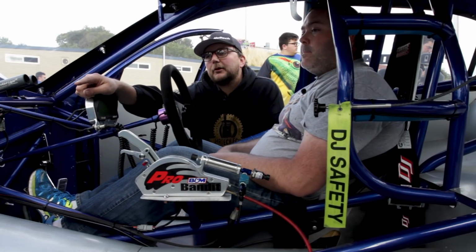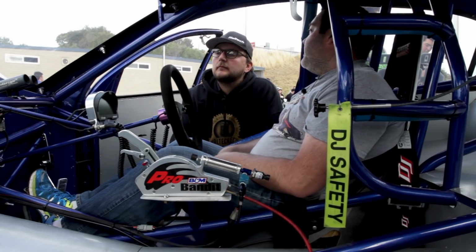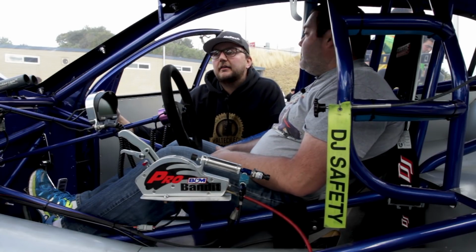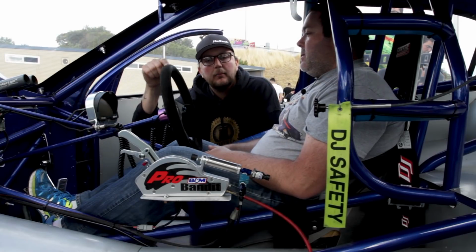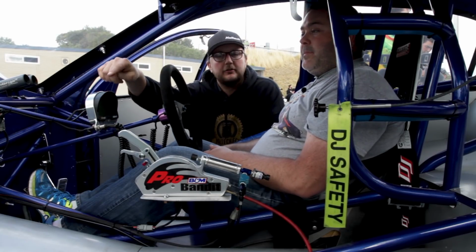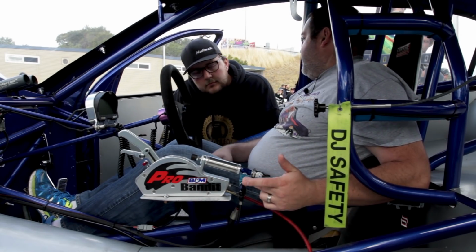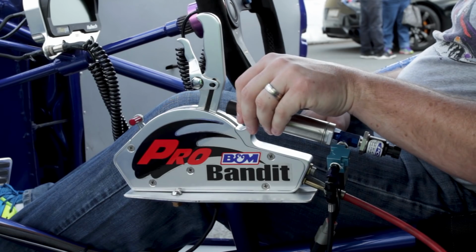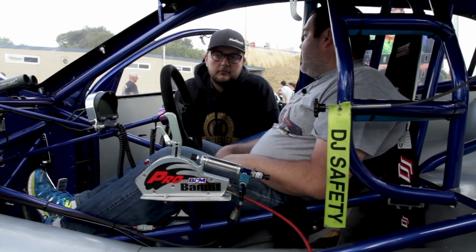The bottle over here? It's a CO2 bottle, does the shifter and the boost control. Right, okay, so we've talked about how the boost control works using the CO2 for the hat pressure. What's on the shifter? So that CO2 is doing this? Yep, so it's just got an air line there, which goes into like a Mac valve, like a boost control solenoid, and then it'll just push that out. So put it back in there, it'll just change into second gear.